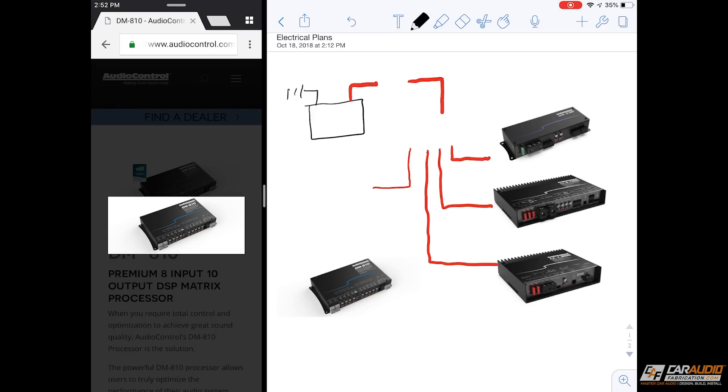We also need to connect the negative or ground wire for each of these amplifiers and devices. So let's say we have a separate large ground distribution block in this area — we'll come out of each amplifier and run it to that block. Up until now we've just been leaving spaces for the distribution blocks, fuses, and the different things we're going to use.